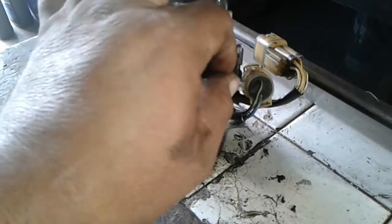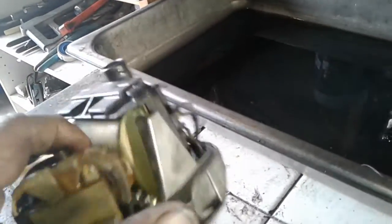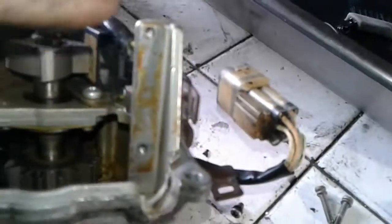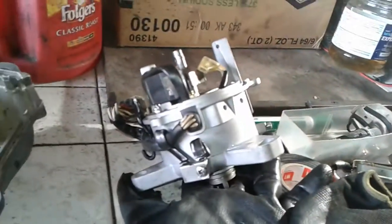While taking this out I noticed this coil has two screws holding it from the top and also one from the bottom. This plug came out of there — you just pop the plug out and it exposes that screw. You gotta unclip the harness all the way around it to get it up and out of the way. Now with the ignition coil out you can see inside the housing — there were four screws holding this coil on. And you can see inside how soaking wet it is — there's oil all over.